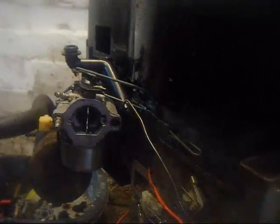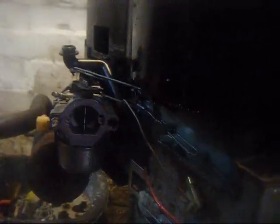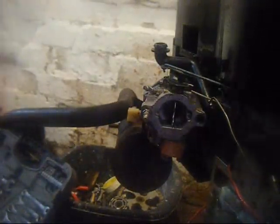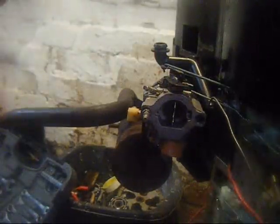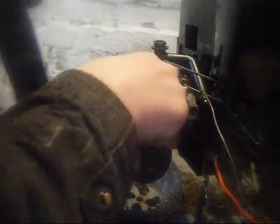Let's take the bowl off — that's easier with a nice spanner. There's a little bit of petrol in there. As long as it's not too dirty — oh, it's got little floaty bits in it. If you're wondering why the petrol looks dark, it's not actually dirty, it's Unleaded Ultra and it's meant to be that colour. Check your float mechanism. There are screws — I think one is for the high circuit, one is low, and one is idle.